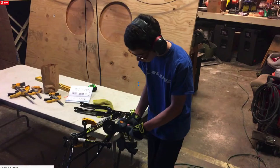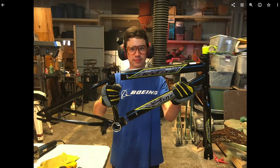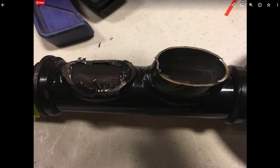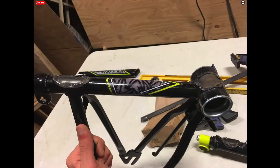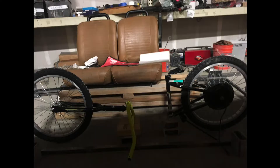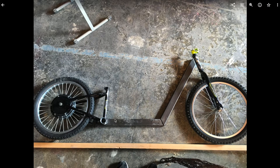Here you can see it cut in half. We also cut the tubes off the headset and ground them down with the bench grinder to make them smooth for welding. I laid out the disassembled bike components roughly where they would be when the bike was built. Here are the cut tubes before we welded them. There would eventually be a support member right here, which would also be the seat back. This is 2x1 tubing with 14-gauge wall, and the wheelbase is about 4 feet.